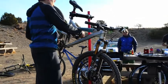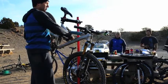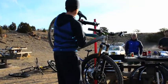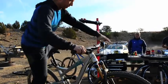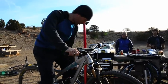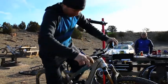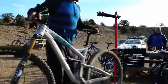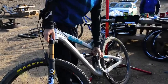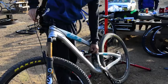Get rider weight in there. On these bigger travel bikes — this one's a 5-inch bike, and we've got some 6-inch bikes out here too — we're probably looking for about 20% sag. The key is to get yourself up on the bike, let it settle into the suspension, push these little O-rings all the way down, then without bouncing on it too much, find your way back off the bike and see where the rings went to. This one happened to be ridden by a really light rider — I've got probably 30% sag there, so we'll reduce that a little bit and add just a bit more pressure.